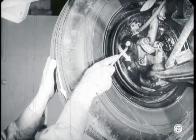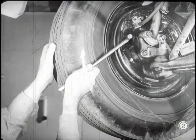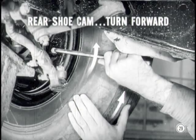Next, adjust the brake shoes to the proper clearance. Starting with the right front wheel, turn the adjusting cam on the front shoe in the direction the wheel rotates when the car is moving forward until the shoe lining is solidly against the drum and the wheel is locked. Remember to turn the wheel slowly as you adjust the cam, Pete. Back off that cam until only a very slight drag is felt as you turn the wheel. Then do the same operation on the rear shoe at the same wheel. Remember to turn the cam in the direction of forward wheel rotation, just as with the front cam.